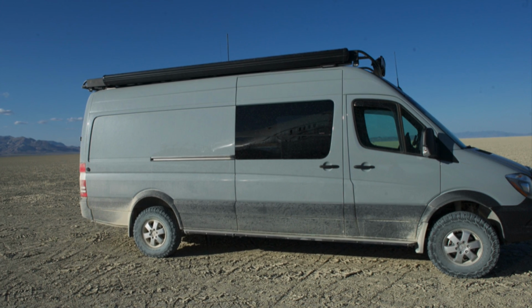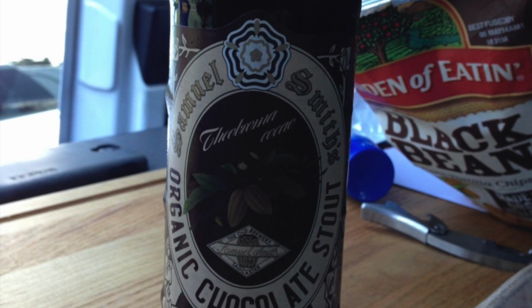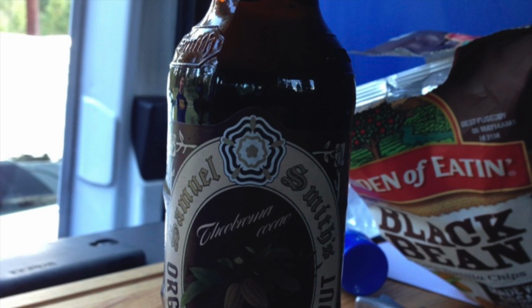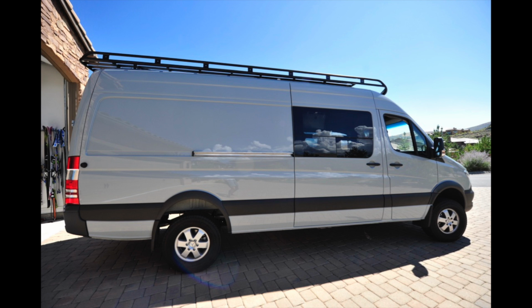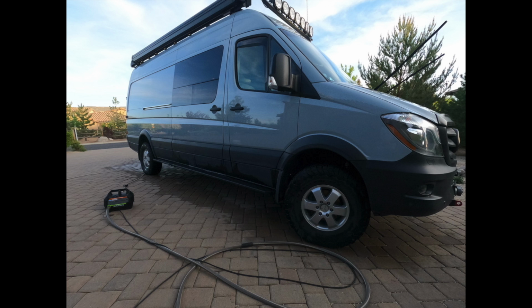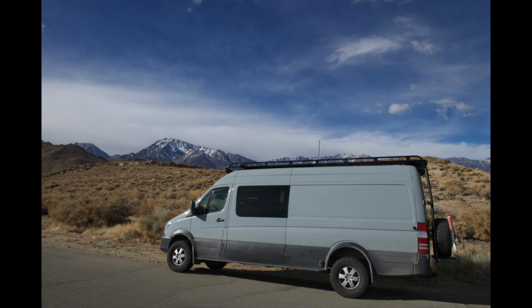After you make these really big cuts in your van roof or walls for windows and fans, but before you pat yourself on the back when you get them installed, make sure that all of your sealant has dried and that everything is sealed up well. The way you test that is to get a hose and really spray it down well, even let water puddle up on the roof, and douse it with water from all directions, and have someone on the inside looking for any leaks. If there are any, correct them immediately so you don't have issues down the road with water leaks.